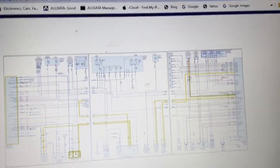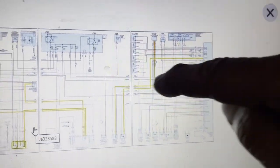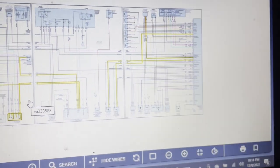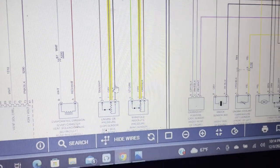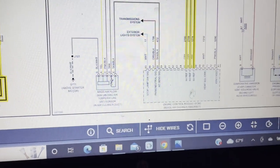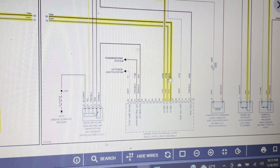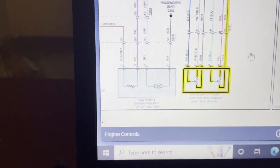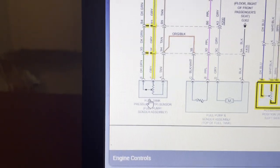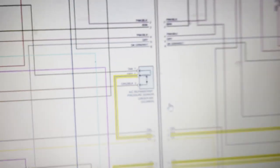Let's minimize the screen and see what it looks like. You can see over here the camshaft — and that is the engine oil pressure and the MAP sensor. Here's the engine control module down here as well; it splits off into the control module. We check those and it splits off three more ways — accelerator pedal I'm not worried about since that code didn't show up, but the fuel tank pressure sensor and the AC pressure sensor did.